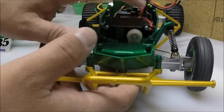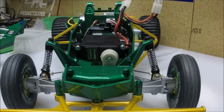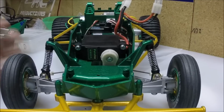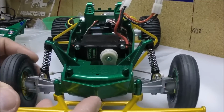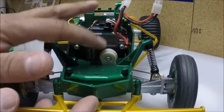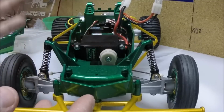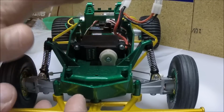And when you work on these servos, I just had this instance. A buddy of mine, RC Kennel 27, just built his first Lunchbox kit and brought it to me, and it was having a couple issues. One of them was that he was steering and it wouldn't hold the steering. As I was looking at it, I noticed it would turn, and then I could turn it by hand, but it was slipping on the servo horn. So I figured he had something wrong with the servo saver, and my initial thought was, I bet he used the wrong servo saver.